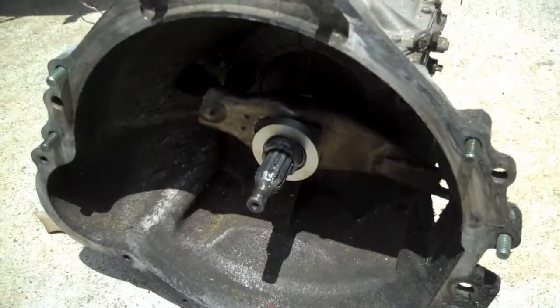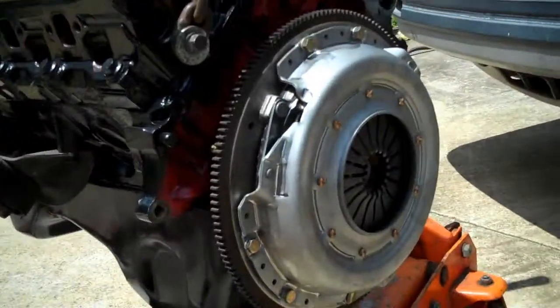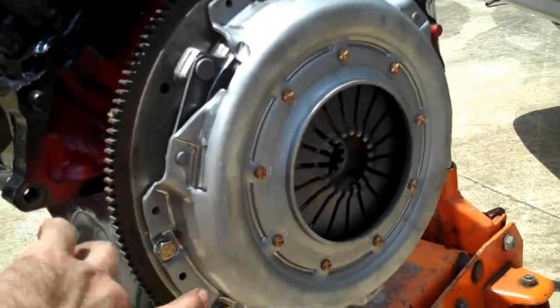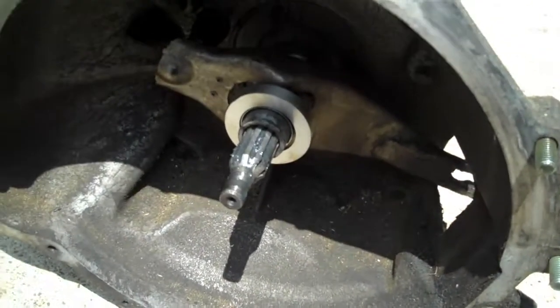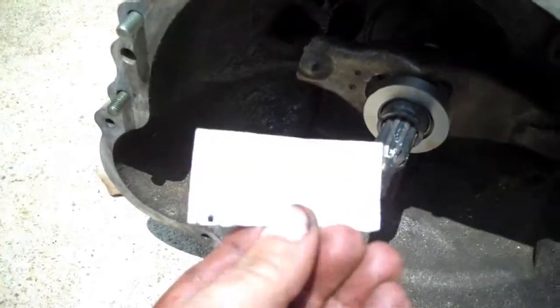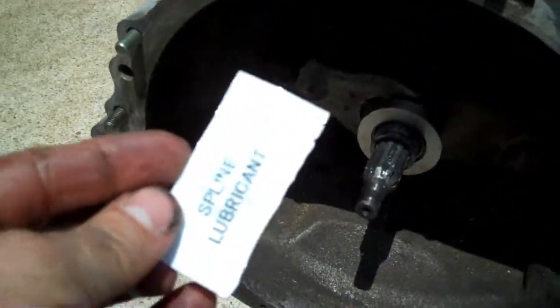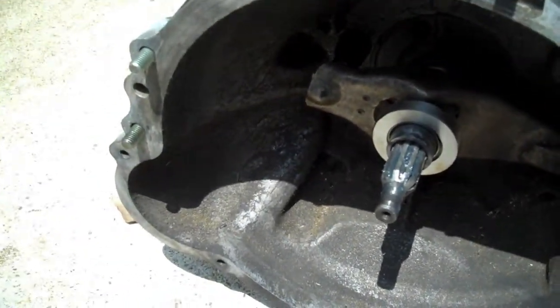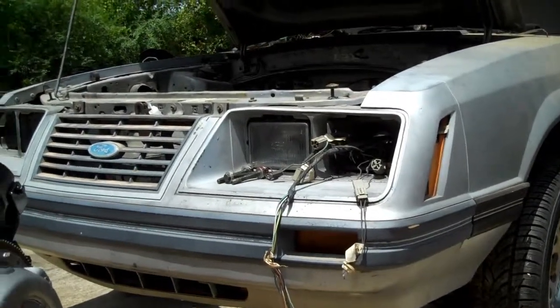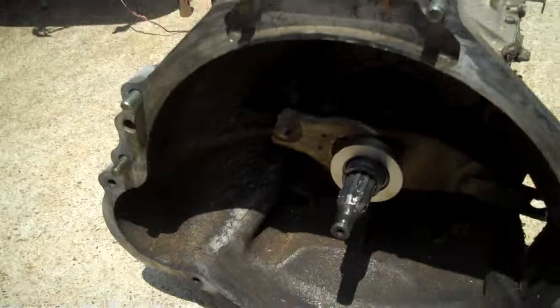Throw-out bearing is installed. This video covered how to set up the clutch: putting in the pilot bearing, putting in the rear main seal, seating your clutch with the alignment tool, the proper crisscross bolt tightening sequence, and for the 5.0 Mustang T5 transmission how to set the throw-out bearing. When you get your clutch kit it comes with a little pack of grease — almost an insult to your intelligence — so that's why I use my own stuff. We're gonna set the transmission to the block and drop it in. Thanks for hanging out, I'm gonna get my little pony put together. Got some more Jeep videos coming up soon — keep checking back, peace out.